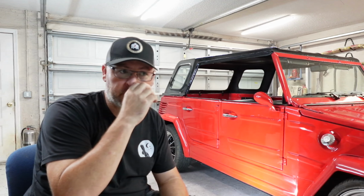He talked to us and said that a lot of the body shops around town are having the same issue, just due to the humidity and whatnot. When they spray their solvent, their wax and grease remover, and wipe down the panels, it's not evaporating like it should. Even though you're supposed to wipe it on, wipe it off, it's just not.